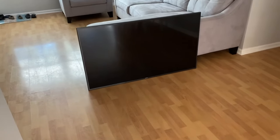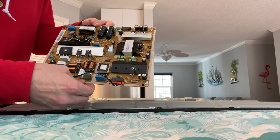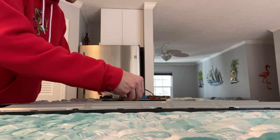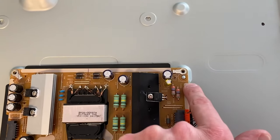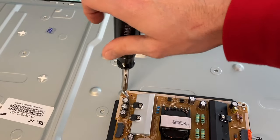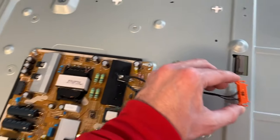There's the old broken panel — now it's time to get to work and install all our parts back on the new panel. Ever so gently, rest the power board in place — the back side is very prickly. Verify your board is properly aligned, checking the little tab and screw holes. Grab the screws and secure it. As you secure each screw, do not cross-thread and do not over-tighten. The power board is now secured by all the screws.